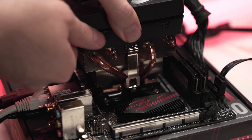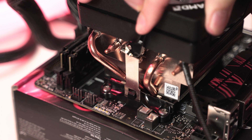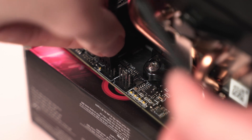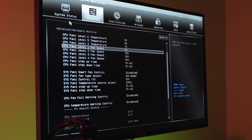To begin the testing, I installed my brand new Ryzen 3900X into my open air test bench and installed the Wraith Prism cooler with stock thermal paste onto it. I wanted to test a variety of circumstances to mimic what the typical user may be using the system for. I made sure the ambient temperature stayed the same throughout the testing, changed the fan curves to ensure the fans were at 100% speed the entire time, and I used the same default profile in Ryzen Master throughout the testing.